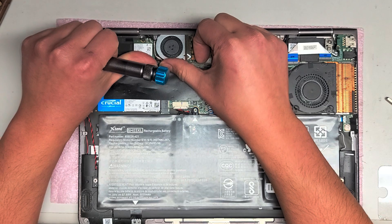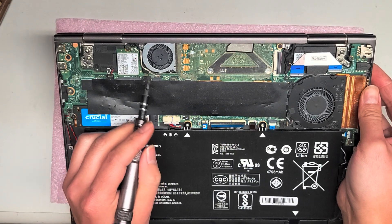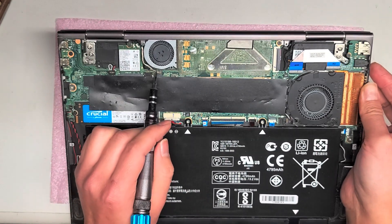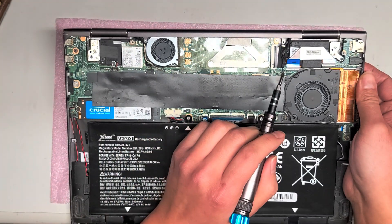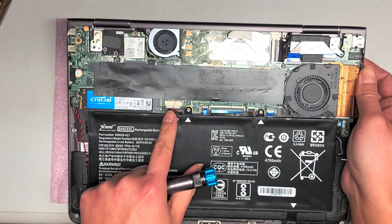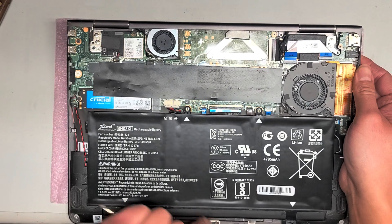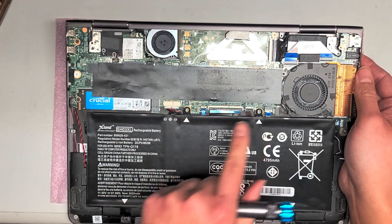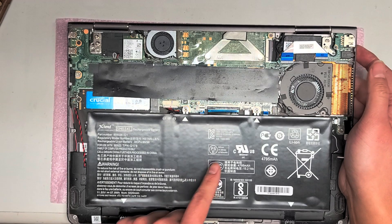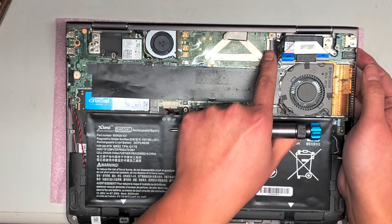There are these connectors — grab the edges and wiggle and pull them back. This looks like for the touchscreen and probably the webcam. One might be for the fan, and the small one looks like for the touchscreen and camera. Then you've got the LCD or LVDS connector. If you want to mess with this cable, make sure you disconnect the battery first. I don't recommend just pulling the cable since there's not much room. You'd have to take the screws out, lift the battery up, and then pull it back slightly while pulling the cable. Make sure to open the screen 90 degrees and press and hold the power button for about 10 to 15 seconds to drain any power before safely removing this cable — otherwise there's a good chance you can fry something.